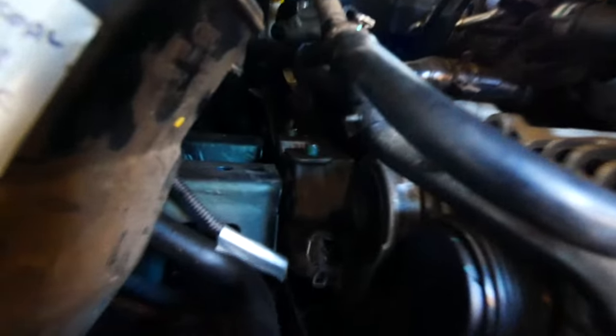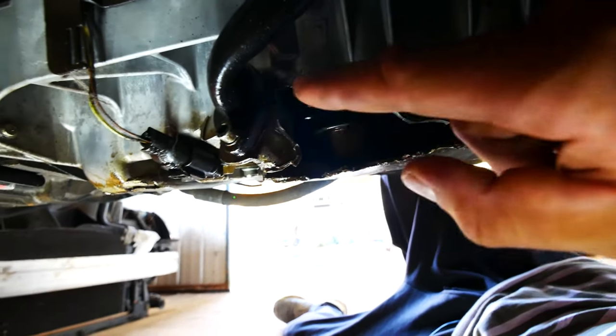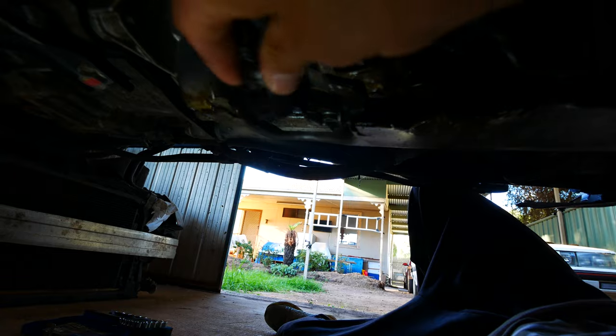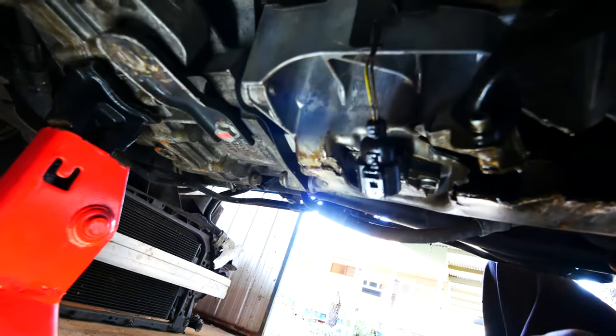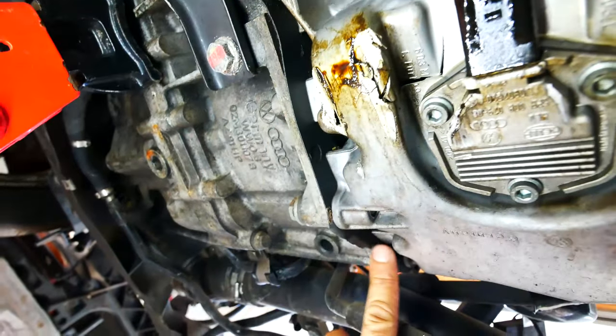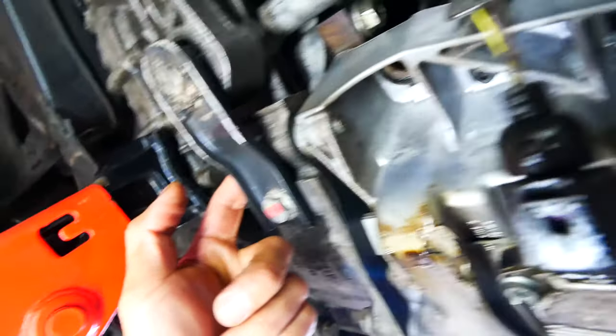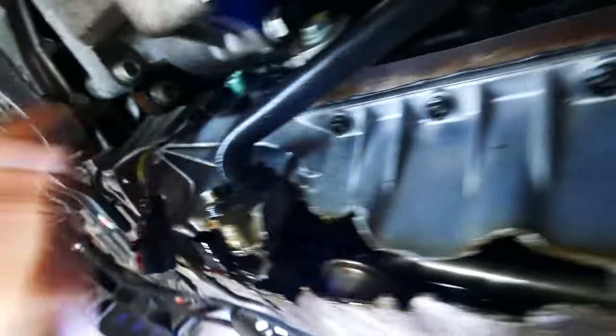We're back under the car at the cracked sump. There should also be a 19mm sump bolt — it would usually be in this area here, but that's gone. You'd want to undo these two little bolts at the turbo oil drain, and then remove this plug here. Then there are ten more bolts around the perimeter of the sump to remove, with some of the most annoying ones being in there — the trickiest to get. Also don't forget there's this bolt here which you can access from the other side of the dog bone that needs removal, and then we should be able to take off the sump.